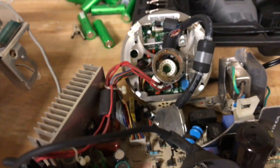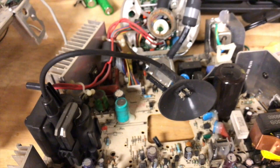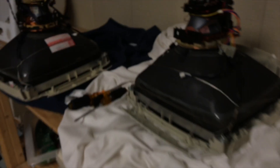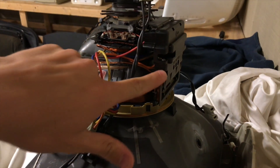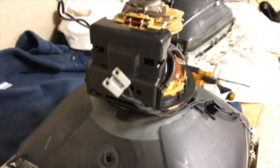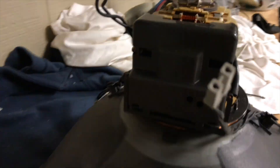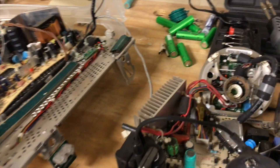This particular iMac has an LG CRT display. You can tell the difference where this plastic piece will say LG on it. Now the analog board I robbed from the new one was from a — forget what this brand's called — Chunghwa, however you say that, but it's not LG.